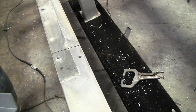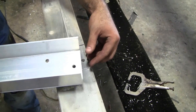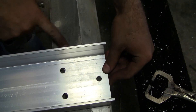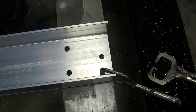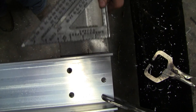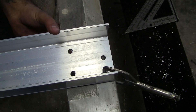Once you have your axle holes drilled out, next move on to your steps. The line that you measured earlier was the inside of your step where the fender mounts to it. Place your new step over your frame, lining up the edge of the step with your previous mark. Clamp it in place and make sure that the step is squared up to the frame. Then drill out your step holes through your frame for the new placement.